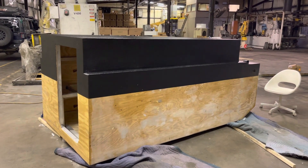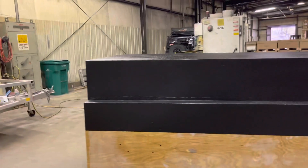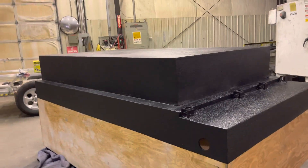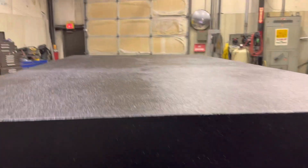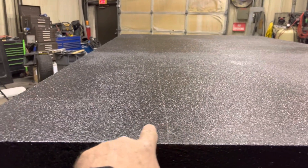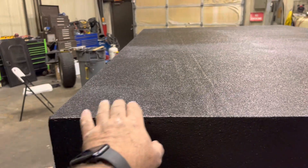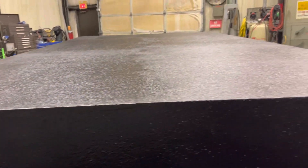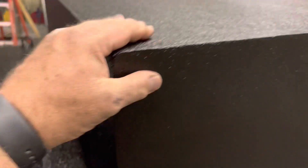Good evening folks, welcome back to Journey Before Destination, your host Gary here. Looking at the trailer — it's still upside down. As you can see from the last video, we put our second coat of Raptor Coat on. Raptor Coat bed liner is some awesome stuff — it's not Line-X, it's not meant to be, but it is super cool, super strong, very nice. It covers up all kinds of stuff. You can see this big patch where the seam of the board was — we epoxy fiber-glassed over it. It covers up all kinds of imperfections, and it's exceptionally thick, strong stuff. This dries and it will take substantial impact and scratch.